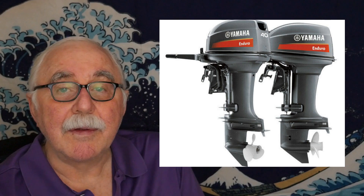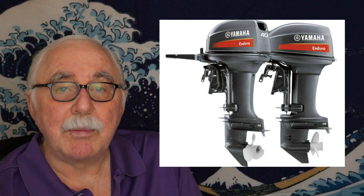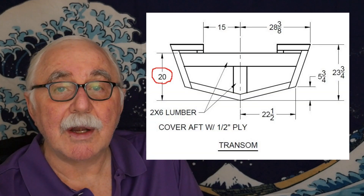It's all a question of how to build the boat for what size shaft motor. For the vast majority of my boats — unless they're little tiny boats — a standard shaft is the preferred size. Most motors from about 10 to 75 horsepower are made in 20-inch shafts, and any boat using motors in that range would be best served with a 20-inch standard shaft. I dimension most of my boats to do that, except for some of the very small ones, which I design around short shaft motors.